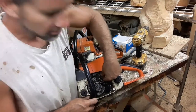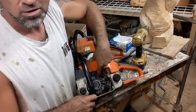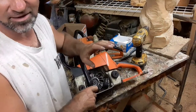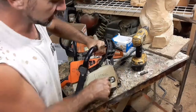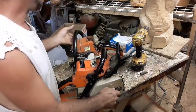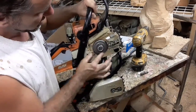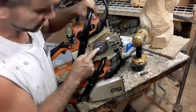That's another thing. You could be getting vibrations if your ground screw is loose. It's going to vibrate. I mean, if you're that sensitive, you're doing really well. Other things we will get into later on down the road. There are all these moving parts here. If your bearing is bad, that could cause a vibration.